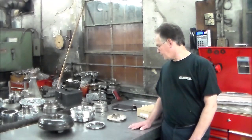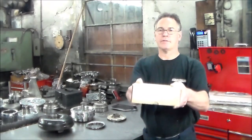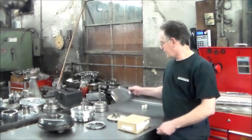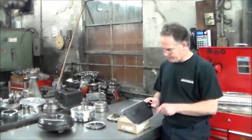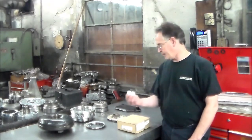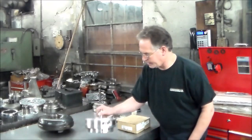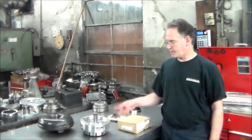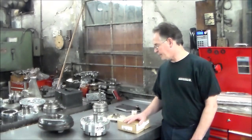I'll give you a close-up shot of what I'm doing here. I have my new pump — I will only use ZF OE parts. I have the new Filtran filter, made in Germany, and these are the two sleeves. One thing to mention: in this pump you have a flow control valve, so you want to make sure you take that out and clean it, because if it gets stuck it's not going to move well.